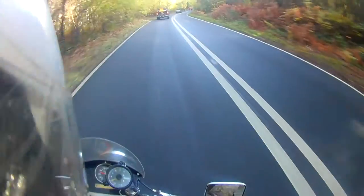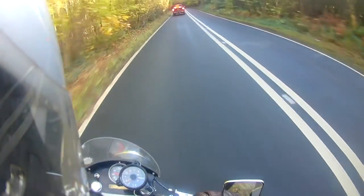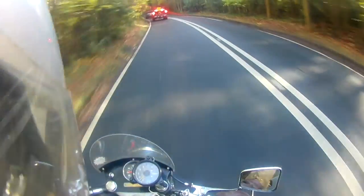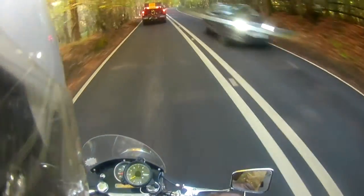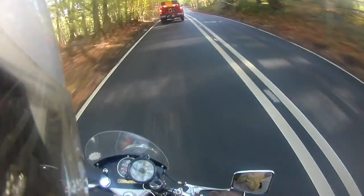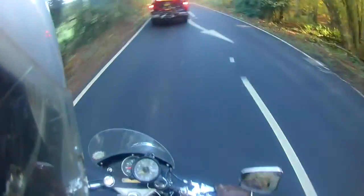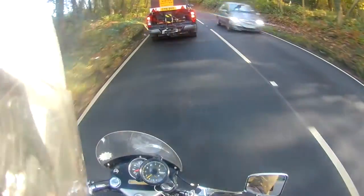Also fitted lights, they're total loss lights, just enough to get you home at night time if you're out on it. The lights will run off the battery for an hour or so, which is enough to get you home. Because it's got no means of charging, it's just got a modern BTH magneto for the ignition, and a little battery under the seat which does the stop light and the main lights. Bike's classed as historic, so it doesn't need an MOT.